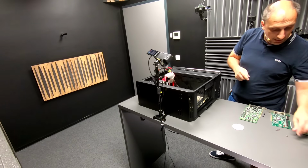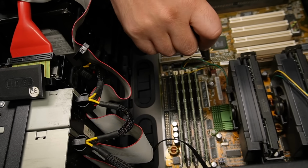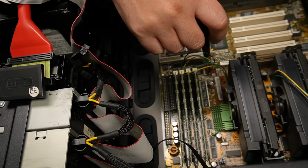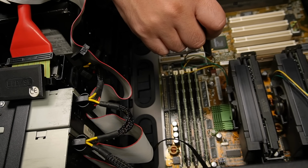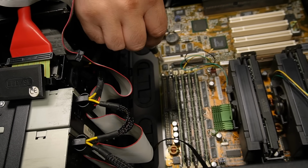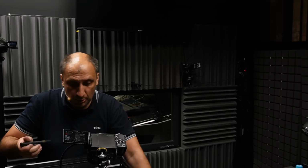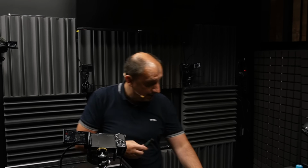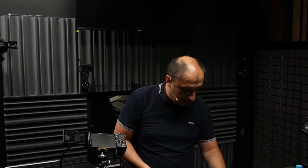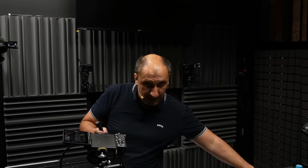You didn't see this, but in the center of the board there's also a place where I could screw in a screw, but I deliberately broke a spacer so that it fits inside those small pins where you can screw in these screws, so that I can orient the board. It's much easier to do it this way. It's something that I picked up along the way. It comes with the experience of building dozens of these computers. This is something that was like a staple to me. I did that many times over, luckily for me.